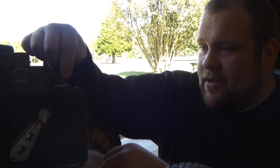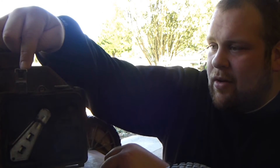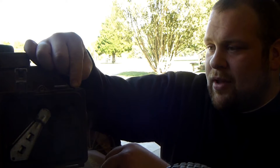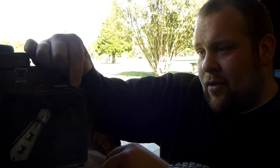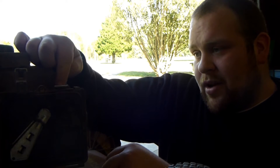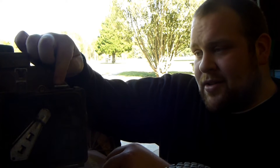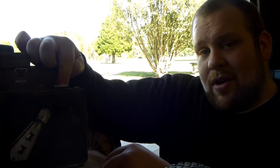What I've noticed is the protective guard which attaches here — that keeps the throttle and governor linkages from being damaged by debris — has been missing. Oftentimes when that cover is missing, the spring is no longer attached. However, that's not the case here since the spring is still attached to the carburetor and it appears to be in good shape.